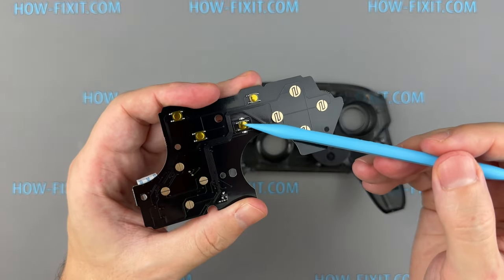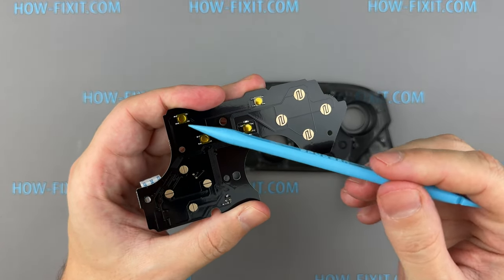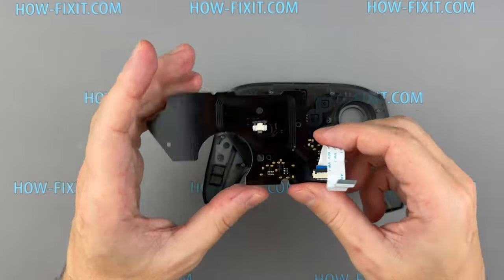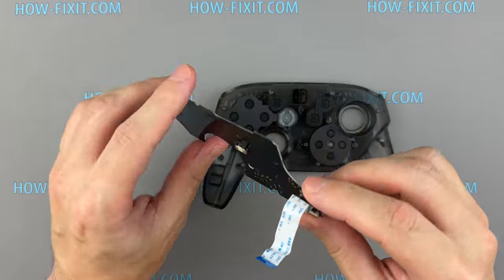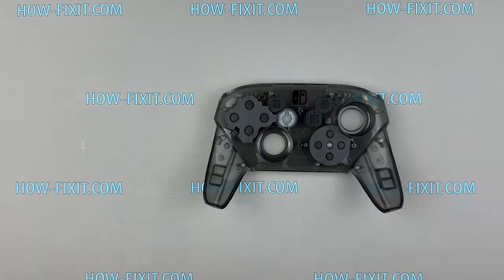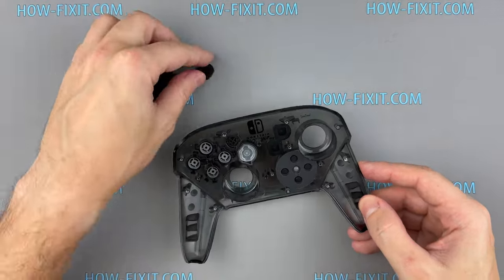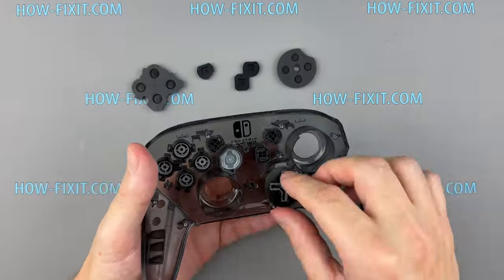The capture, minus, plus, and home buttons have a physical mechanism. If one of the buttons does not work, you have to replace the mechanism, but this repair requires soldering experience. Alternatively, you can replace the control button board. I've left a link to the replacement control button board in the description below.